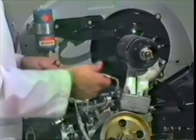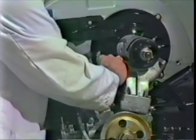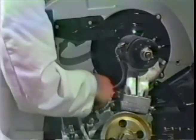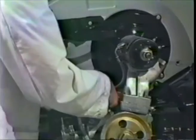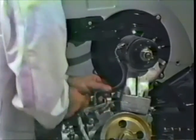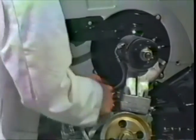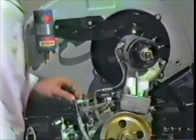Here is your return line from the filter. You twist it around like this. Screw it onto the fitting we put in the case, all CAD plated. You can hardly see this since it's in front of the distributor, but the Porsche guys know if you plated it or not. I like to plate all the fasteners except the ones I mentioned, the case acorn nut washers and that sort of thing. Rod nuts, of course, don't get plated.